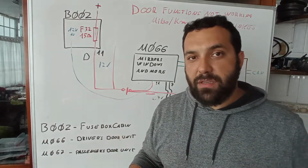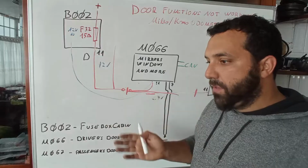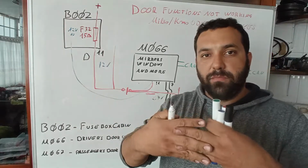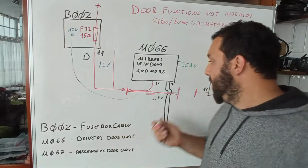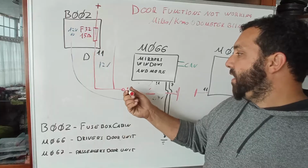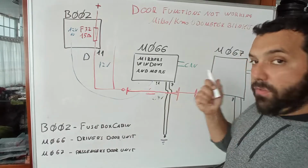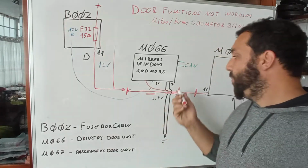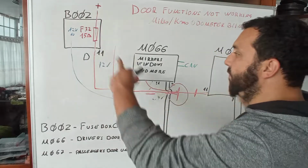Another thing that I see a lot on French cars, and we are getting to that because of the junction of FCA with PSA, is somewhere along the way, in the middle of the control stack, for example, you have over here a junction, just a junction. The wires break along the way. Okay, I could have this problem over here. Just imagine this, I have the wires over here, okay, and on the junction box, a second wire comes to here. If you have a problem on the junction box, you have 12 volts all the way and not for the control units.